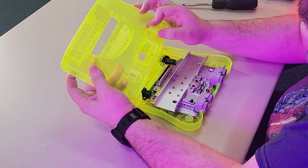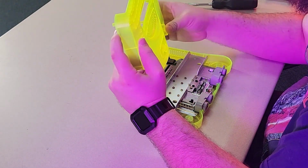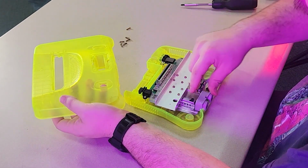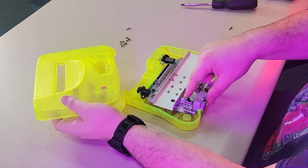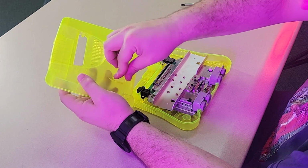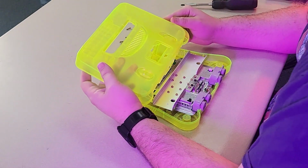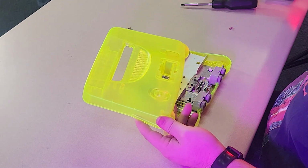Yeah, so I'm gonna go ahead and pop the reset button back in, pop that in, get our power in, and then one real important thing when you're going to put it back on: you want to make sure your power, if it's up or down, I always just have it facing down, but you want your power button to be in that same position so it goes over it properly. It's just one other thing that you can miss when you're trying to put it back together.